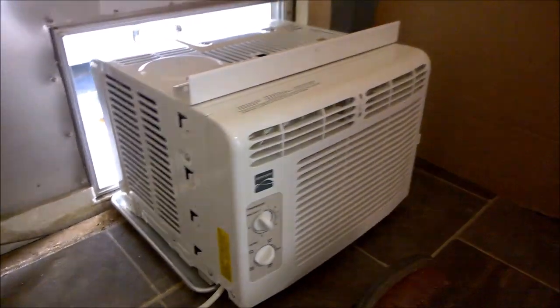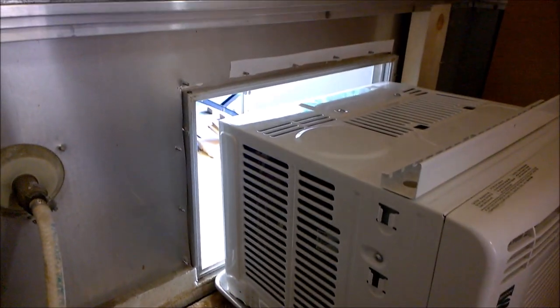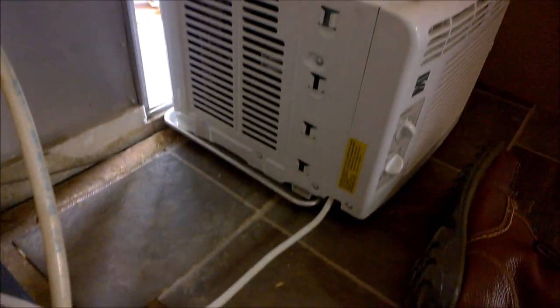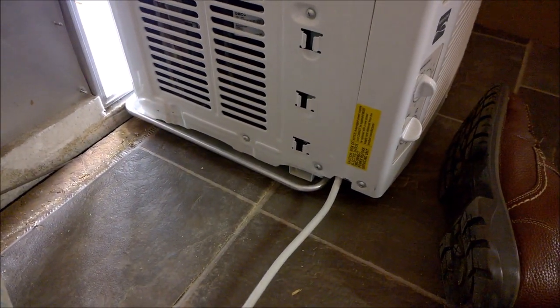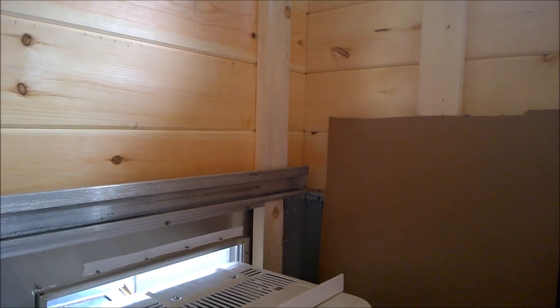But what we can do is what Jayco and a lot of other mainstream manufacturers do — we can build a frame around a regular window unit inside. When we want to use it, we'll open that access panel on the outside. When we don't, we'll close it. There'll be a grate and screening so we don't get bugs inside. For drainage, I've got an aluminum tray from the garage that fits this absolutely perfectly, so we can put a drain in the bottom for condensation. And there'll be a frame around here, leaving space for our kitchen area, maybe some shelving or an L-shaped counter. Still working on that.